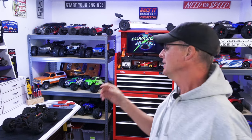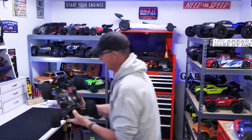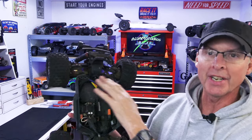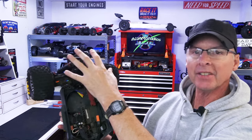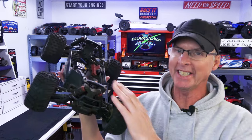In the last video we showed how to get the slipper clutch assembly, motor, and that whole cartridge out of the car, so we'll skip that here — check Part 1 if you need it. Right now we've already got the slipper clutch and motor out. We need to take things apart on both ends to get to the differentials and have a look at the drive lines, which means the shocks are all coming off. Since we're removing them anyway, we'll go ahead and install the new shocks while we have it apart.